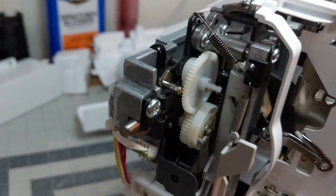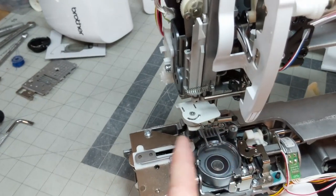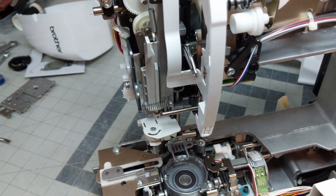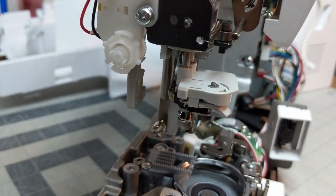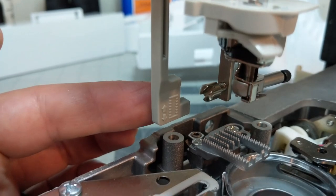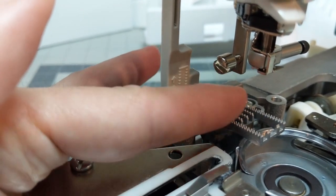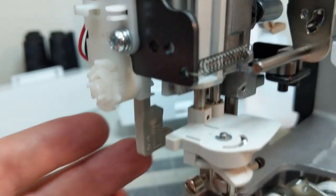We already kind of looked at this before — you've got a bunch of gears in here too. That's how you get all the zigzags, so the needle moves left to right — it doesn't do that for embroidery, but it does that for any of those special stitches that you can do without being an embroidery machine, just as a regular sewing machine. Not too many people use this ever, but that's for when you're doing button holing — you have a little jig that goes on here, and when it goes to a certain point it hits that and it's going to stop and then come back. That's actually been around for many years and it's the same assembly, just now it's electronic instead of what it was in the past with little switches and things.